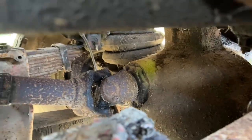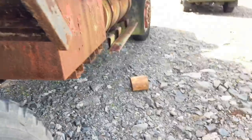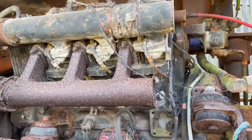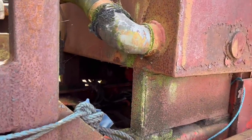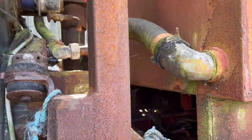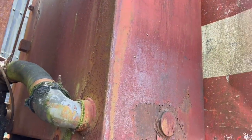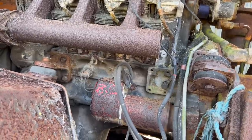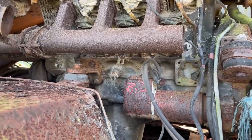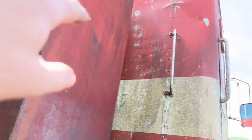You can get in here and look better and see the big rock welds. It's a 6-cylinder air-cooled Deutz. This runs all the hydraulics, because whilst the truck has got a PTO take-off on the 10-speed and the 2-speed transfer, it'll always be running at the wrong speed to drive the pump at a constant volume. So that's that — big hydraulic tank. And some idiot stole this truck back in the early 90s I think it was. They tried to move it, started the wrong engine — this one — and sent the 15-tonne slab of steel that sits in there back into the cab, which is why it's all dented.